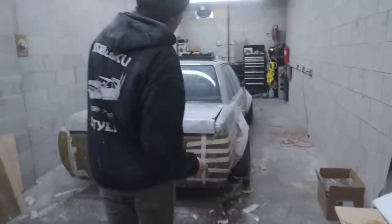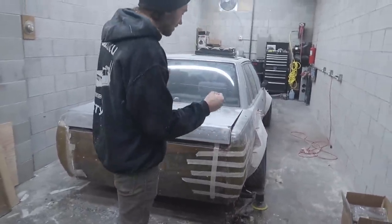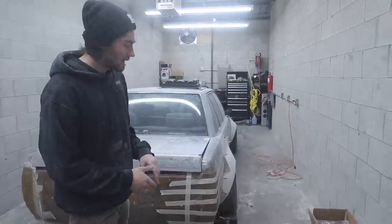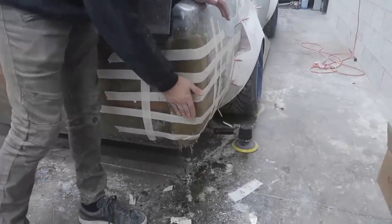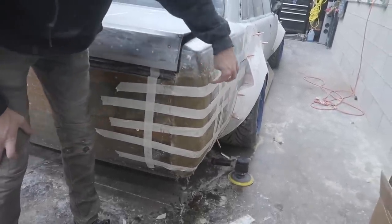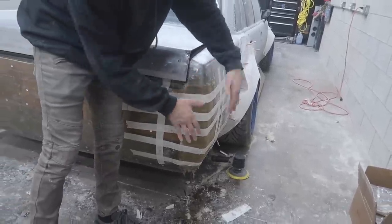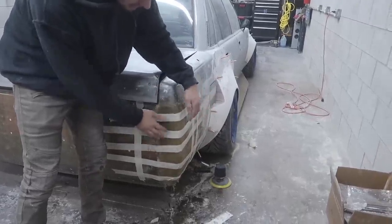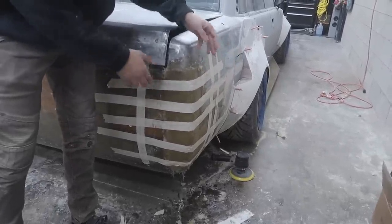In addition to that, we got both these sides completely clayed up, modeled out, and then completely done with fiberglass for now. This one, we got completely molded in now. There's nothing in here besides more fiberglass to seal everything up. So now that there's fiberglass bonding this, from there we are going to sand this down and then do another complete fiberglass to really seal everything in and get a little bit more thickness out of there. And then from there we'll start doing some filler work.